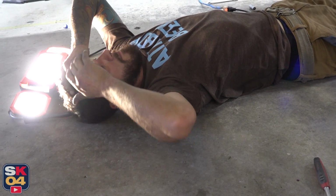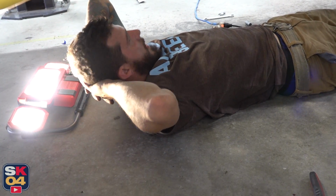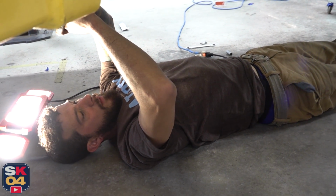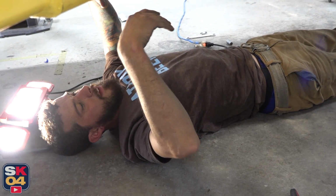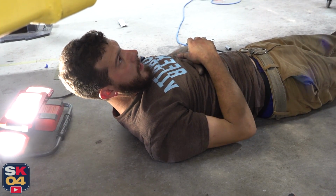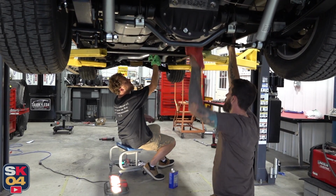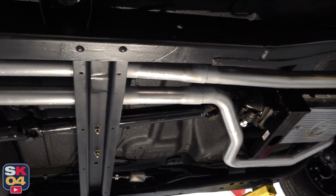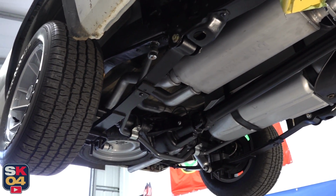Oh my gosh. What we discovered literally about 1 minute ago is that we really had no way of getting these two inner bolts locked down with lock washers until we walked away and then thought about taking the lock washer and putting it on the bolt side and not on the nut side. And now Kyle is from the top of the truck pushing this nut down through the header. And there you go. That's the last one. Man, oh man, this looks really, really good. Now we just gotta put the tips on and we can fire it up and see how she sounds.